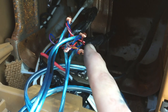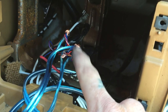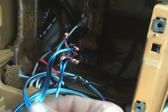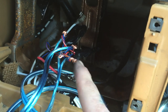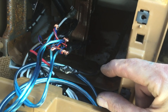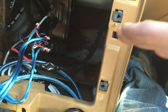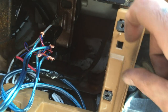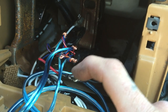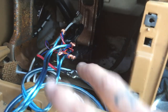All the right positives, right negatives, left positives, and left negatives are wired in, and I've tested it — everything works. This is where I could definitely see wiring in a couple of pots between these different sets of wires. For example, for the bass subs in the lower back, you could have a knob that adjusts that level so the subs compared to everything else can be turned lower or higher.